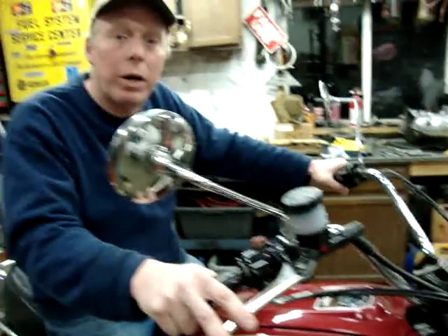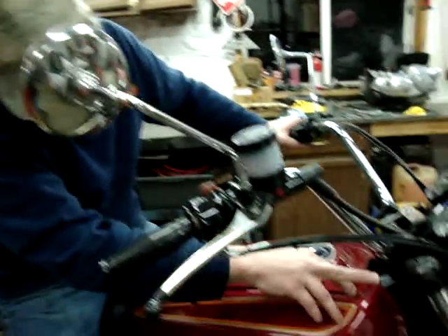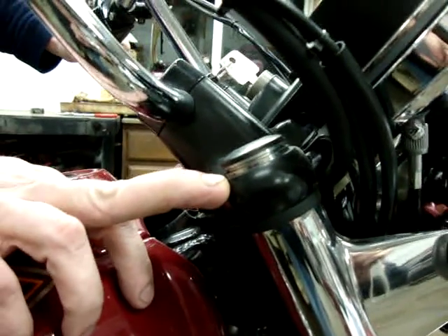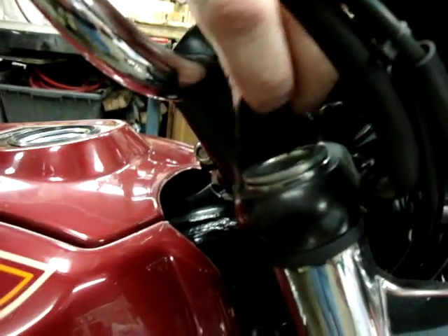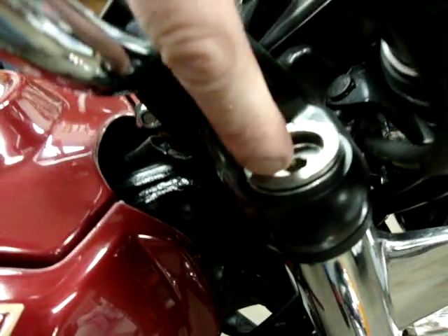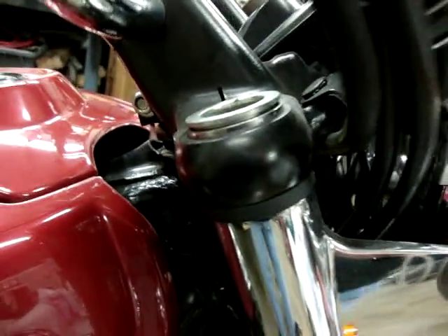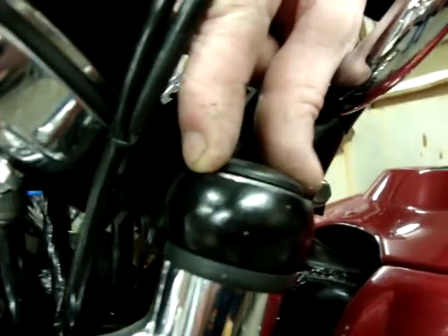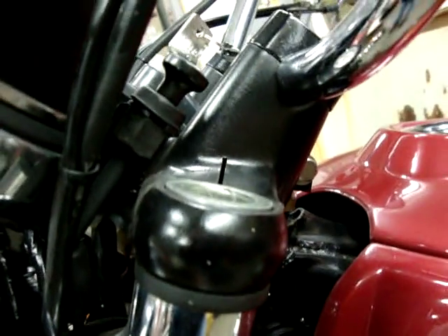What we need to do is try to re-tighten those bearings to make sure they're torqued properly and work off of that. The second issue is over here on this fork tube — you can see it's actually protruding very slightly above the top fork clamp. The fork cap is not tightened, and you can see a gap here; that's what retains the spring in the front fork tube. If that were to back all the way out, the spring could come out. This one is correct — if I remove the dust cover, you can see that one's down flush like it's supposed to be, and the fork tube is clamped in properly.